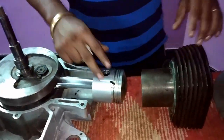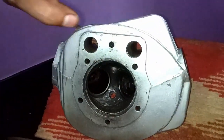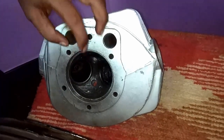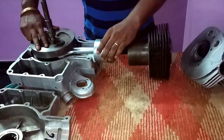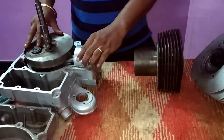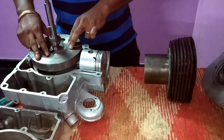When it reaches the top, we will have two holes — on one side we will have the spark plug and the spark gets initiated. Due to that, an explosion will happen which pushes this piston backward. That stroke is considered as the power stroke. After this power stroke, the piston again reaches the BDC.